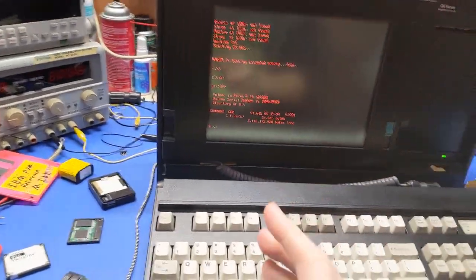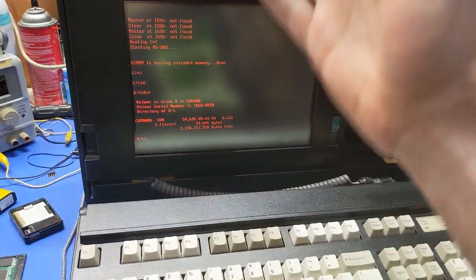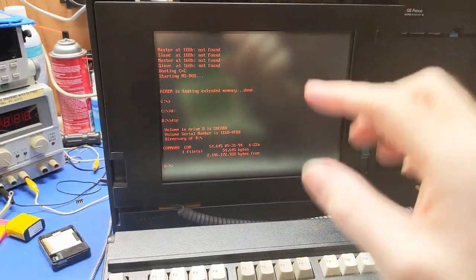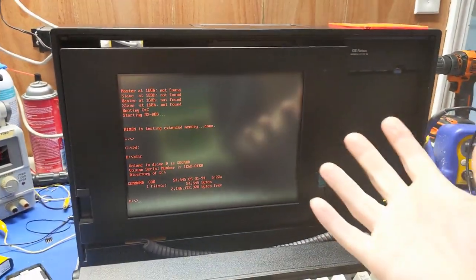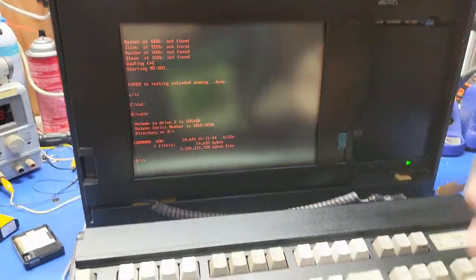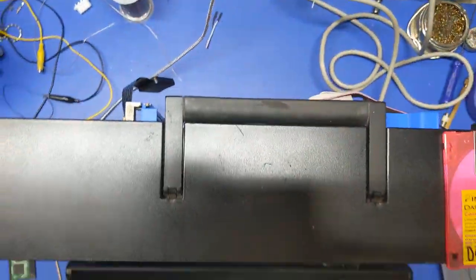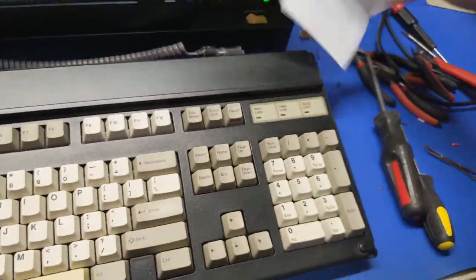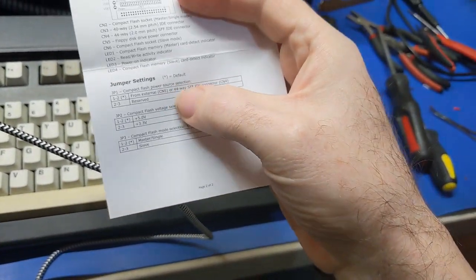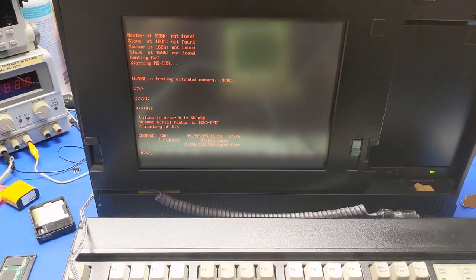Turns out, after fiddling with it, the P70 setup program has the settings for the BIOS, of course. Well, by default, it shuts the secondary IDE controller off on this card. It's configured to do that. And I'm thinking, don't. So I had to go in there, turn it on, assign it an IRQ. Now, my second drive shows up. And I had this thing all ripped apart, put back together, ripped apart, trying different things. And I was even going through this little user manual guide here, and I was playing around with these jumper settings and trying to do master slave. Nothing was working. It was so painful. But it works now. It works now. So now we can move on and get some kind of a DOS installed.